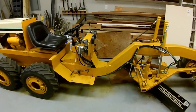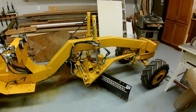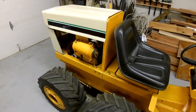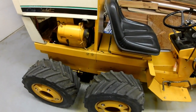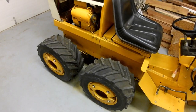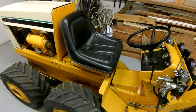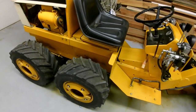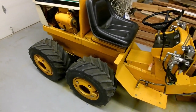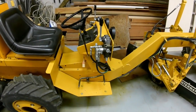Here's a quick overview of the Cub Cadet motor grader that I built last year. It's approximately 13 feet long, it weighs about 2,000 pounds, it's powered by a 12 horsepower Cub Cadet K301 Kohler engine, and uses two axles taken from a pair of wide-frame Cub Cadets from the mid-70s — one model 149 and a model 109. The seat is a standard Cub Cadet seat, and the frame is the original Cub Cadet frame extended by about three feet to allow for the second axle.